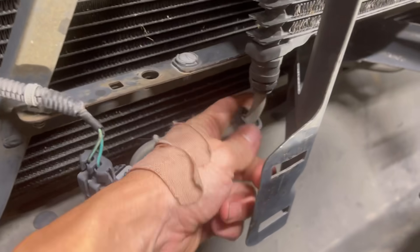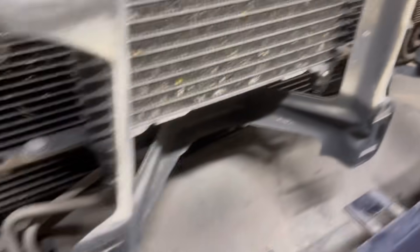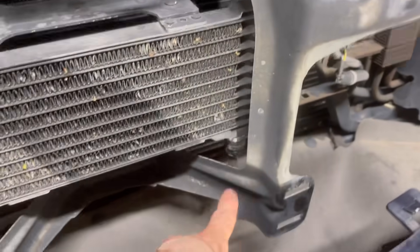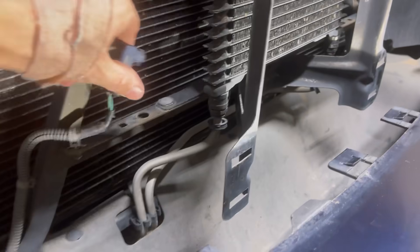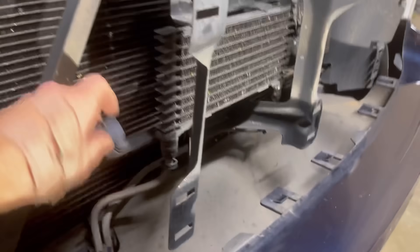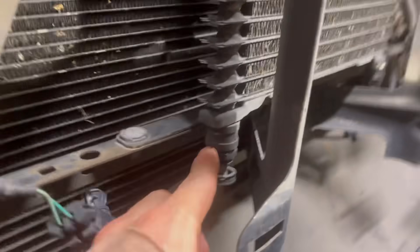Before we get started, we're going to remove our retaining clip covers off of our cooler. I'm actually going to be cutting my cooler lines and doing an A-flare because these things are 90 degrees straight up and the way I'm running my cooler it won't work for me. Right here we have our ambient temperature sensors on both sides. We'll get our clips pulled — you have a 10 here, a 10 here, and then also a clip there as well on both sides.